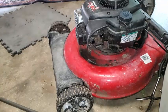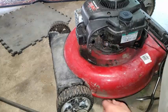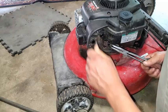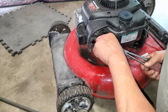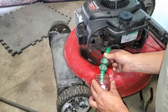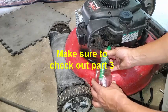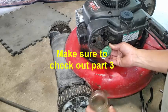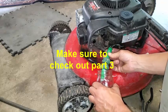Now we're going to go for getting the water — if there is any — out of the fuel tank. I'm going to pinch the line off real quick, then get this hose over the fuel line and fill up this jar a little bit with some of the fuel that's in the tank. We'll just let it drain a good bit down into this jar, then lift it back up and put the plug back in there. I'll take out some more if it wants to flow — just let it drain down into this.